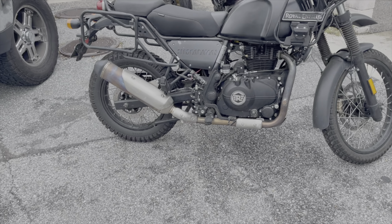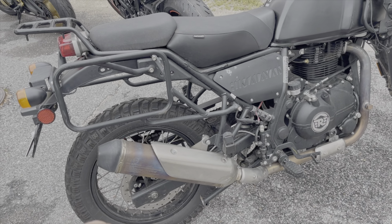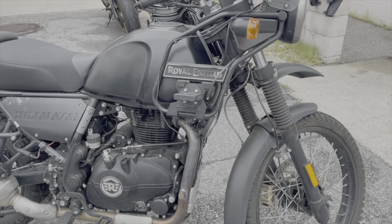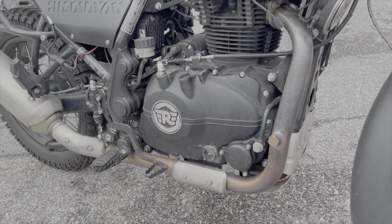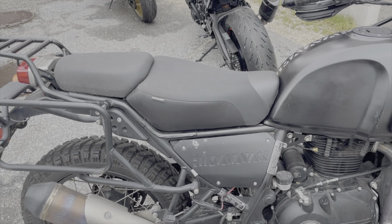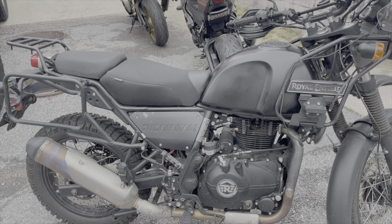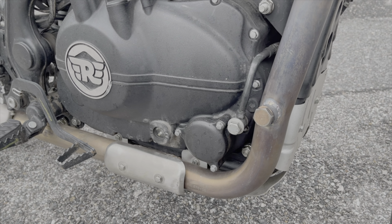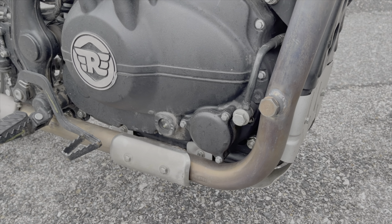Okay, so the biggest problem we were having is we couldn't stick a probe down the stock exhaust. So I ended up trying to get a new exhaust, but there was no place to put it on. And we couldn't test, there's an O2 sensor in the exhaust, and we couldn't unplug it to get to that O2 sensor because the computer needed it. The Powertronics needed the O2 sensor, so we couldn't stick a sensor in where the O2 bung is. So he ended up welding a new bung in right there. And he used that downstream of the normal O2 to get the proper readings on the air fuel.